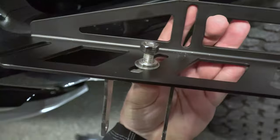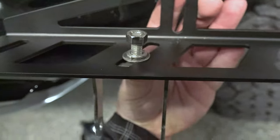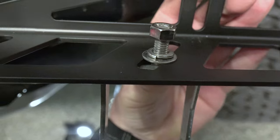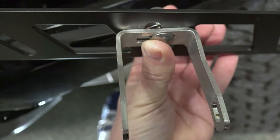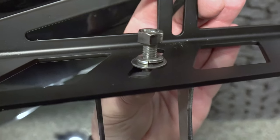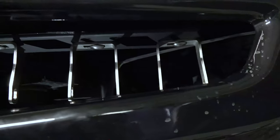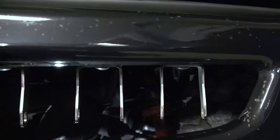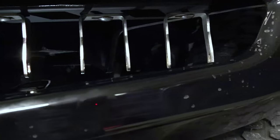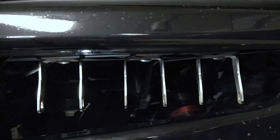The next thing we need to do is install our mini brackets that go into the lights into the large fog light bracket with the three slots. It's harder to show this once it's up in the bumper, so I want to show you outside first. You can see down below you've got a washer, a lock washer, and the bolt on top of that — that's how you insert these from the bottom side. The carriage bolt goes through your small bracket up through your large bracket, then your washer, lock washer, and nut. Now we've got three brackets installed in the bottom of our main bracket. That is going to sit flush with the ridge of the front bumper and our lights will go inside that.